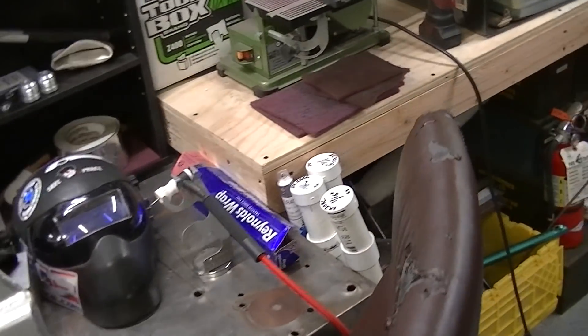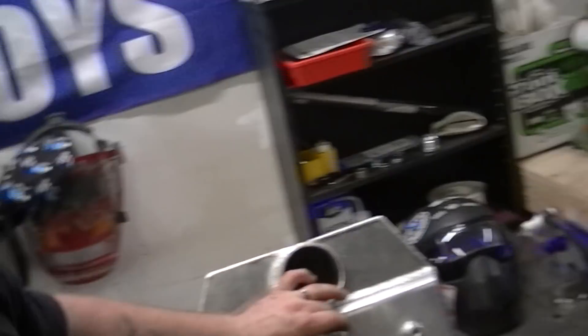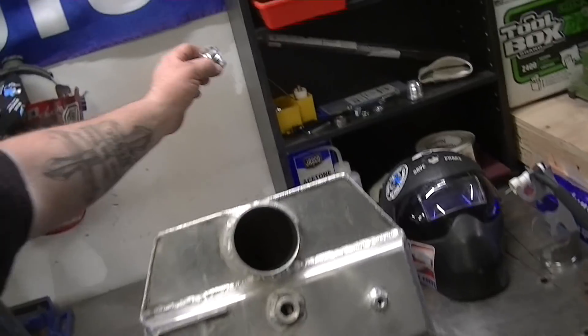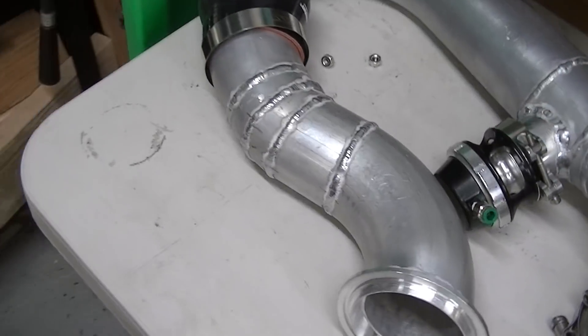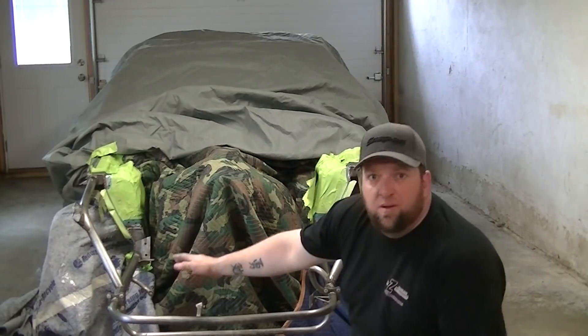While it's off I have a couple of things to weld up. I got some dash 16 fittings from Mike over at Monkey Fab which I'm gonna weld in here — that'll save me some time with fittings. I'm also going to do my wastegates because I've got them all marked — one gate there, one gate there. Gotta cut this all out, grind it out, fit it up, paint those, and tack some beads around this so it doesn't slip out.